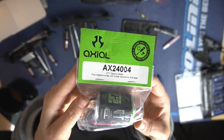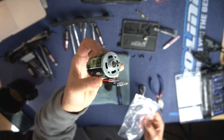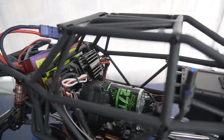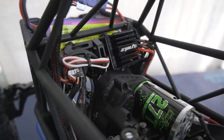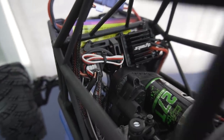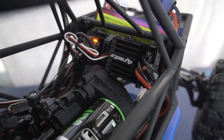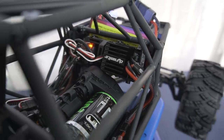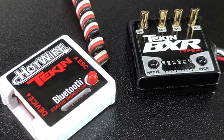For the motor, I went with the 27-turn Axial 540-size brushed motor — this will do the job, though folks have mentioned I probably want a higher-turn motor. The Dynamite ESC lets you adjust drag brake between 50 or 100%; I set mine to 50, and you can also switch between NiMH and LiPo battery. It's not a ton of tunability, honestly, but it'll do the job. It's a really budget-friendly setup. I was actually eyeing the Tekin BXR, which has a lot more programmability — I might upgrade to that in the near future.